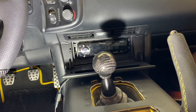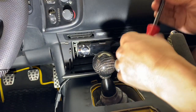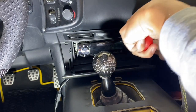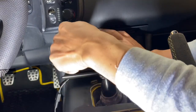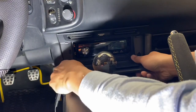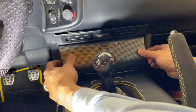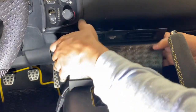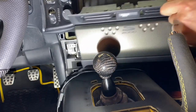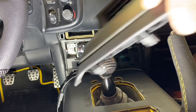Previously we installed a Pioneer radio hooked up to the stock speakers — it gave us CarPlay and the basic features we needed — but now we want better sound. We're going to pull the radio out to run new speaker cables for the new amplifier. Using a trim removal tool, carefully work your way up on the top to pull the trim ring out — there are just two clips. Wiggle the bottom and it comes up. There's a small green plug; push the tab to release it, and that will expose the radio bolts.